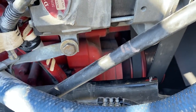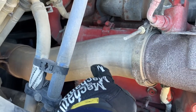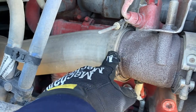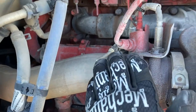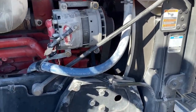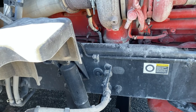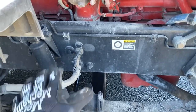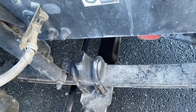The last thing to mention on this side is the exhaust — the exhaust is not bent, cracked, or broken, and there are no signs of leaking. If there was a leak you'd see a lot of black soot around the connections. Everything's mounted, all clamps are mounted securely, no leaks on the exhaust. That's it for the right side of the engine. The same things are over on the other side, but because you already mentioned them you don't necessarily have to mention them here for the test — you don't have to check both sides.